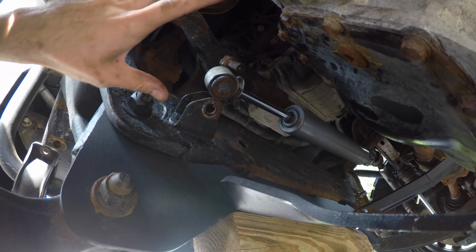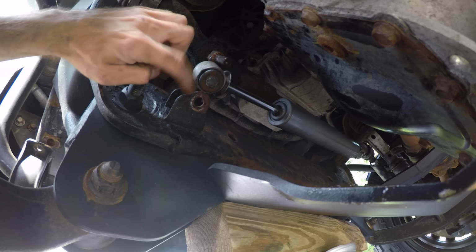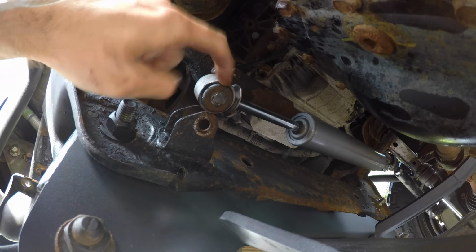One important detail I forgot to mention is if you have a steering stabilizer, you're gonna have to move it out of the way from this bracket mount on the frame. This way you can move the steering and center link up. You're not gonna be able to move any of this if this is connected. And with a breaker bar, you can see I can move the whole assembly